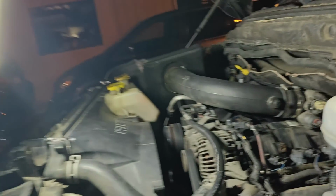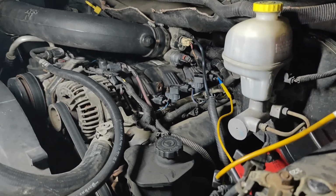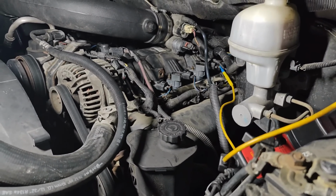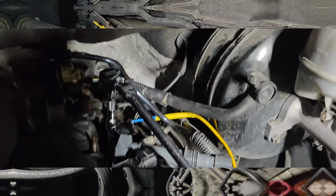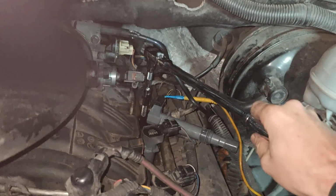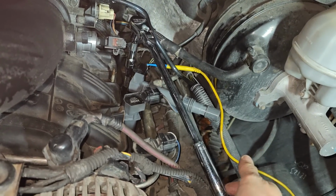So I'm going to shut this off. We're going to pull that spark plug out. We're going to go in cylinder and we're going to check it. Maybe they got a broken valve spring in that. I guess we could go after the oxygen sensor codes, but we've got to figure out this misfire too. This is more important. Okay guys, so we might not be doing the in-cylinder test that I was going to do because I can't loosen the spark plug. I'm afraid it's going to snap.